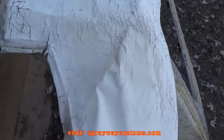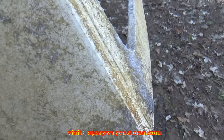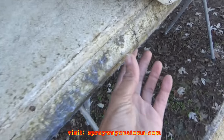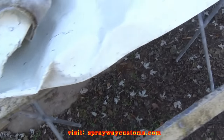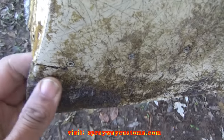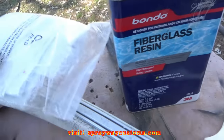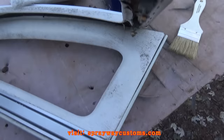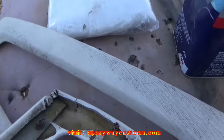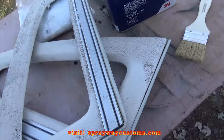This was part of the old vinyl here. Let me take it off and show you the spots I got to repair. There's a crack right here in the fiberglass — go ahead and repair that. It's also one here, then there's another one on this side right here. I'm gonna go ahead and repair that. I'm just gonna use some Bondo fiberglass resin and some fiberglass mat. I still got to take these pieces here apart — it looks like there's a little crack up in there too. Let me go ahead and get set up.